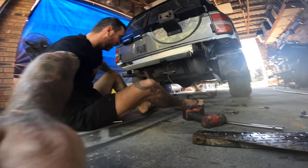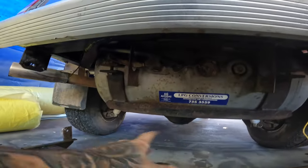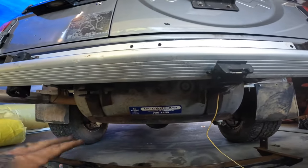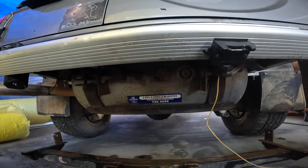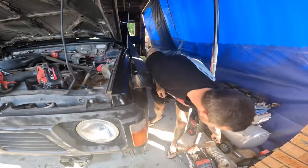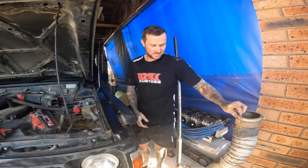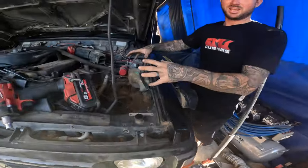Just trying to disconnect the gas tank. Just behind the tow bar there's a shut-off switch right there - I'll shut that off so nothing comes out of the tank when I disconnect it. Then I'll turn the car on, put it in gas, let it run until it dies, so that gets rid of all the gas in the hoses and lines, and then we should be able to drop that out.